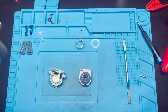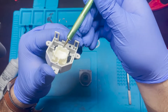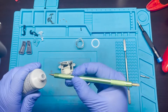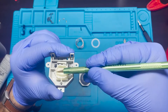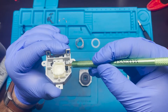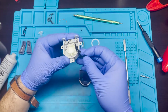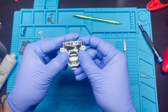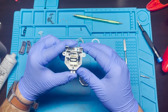I may have put a little bit too much, but that's not going to harm it. Just kind of thin it out using the dry part of the swab. One of the things you're also going to want to do is apply some of the grease into all four of these cutouts right here — there's kind of like a little U-shape on all four sides where this stuff is going to rest when it turns. It helps to put a little bit of grease on that. You don't have to put too much, just enough. Now that that's done, we're going to go ahead and start putting everything back together. We want to start by putting this longer cutout first with this side to the right — you want to make sure it's aligned perfectly in the middle, centered.